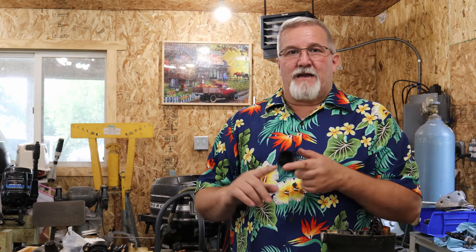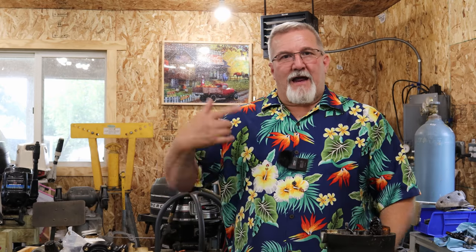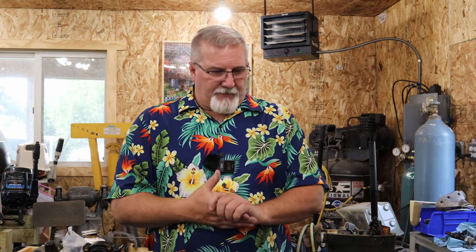I then change the gear oil again because I want to see what things are looking like there, because besides the power head running properly, the gearbox is transmitting the power to the water under severe load. You've got that 20 horsepower, that 10 horsepower going through a 90-degree gearbox, and you've got a prop. You don't think about that, but these engines are under a load all the time. They don't get to coast, because even if you're idling, it's still under a load.